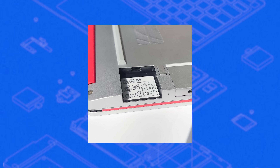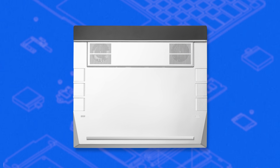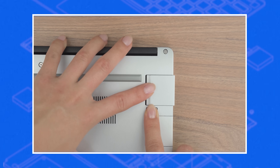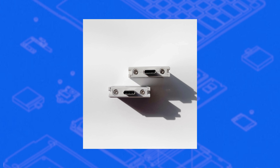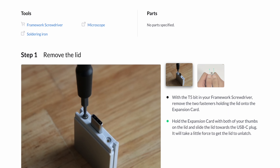It's held in place with a rail and latch system that keeps the card firmly in the laptop chassis. On the Framework Laptop 13, you press this button and pull the card from the chassis, and on the Framework Laptop 16, you toggle a switch. This little plastic ledge gives you a place to hold while pulling the expansion card out. It's held together with two T5 screws and it's designed to be accessible for upgrades and circuit level repairs.